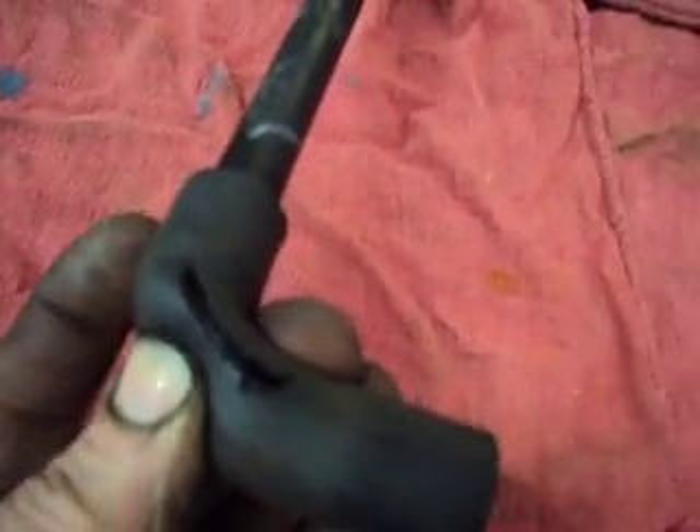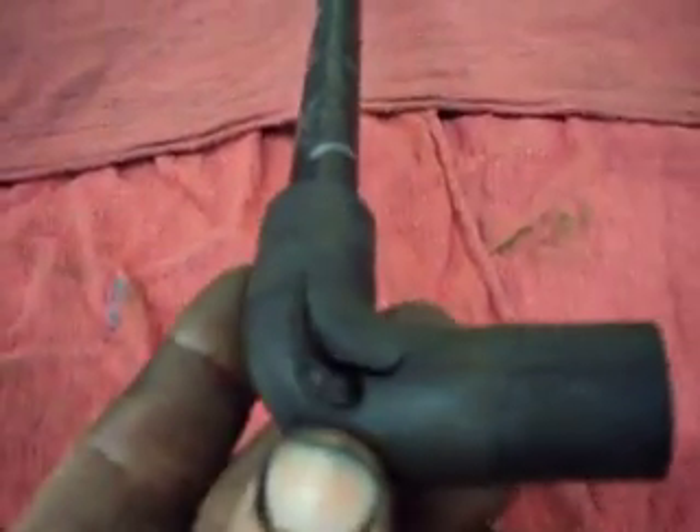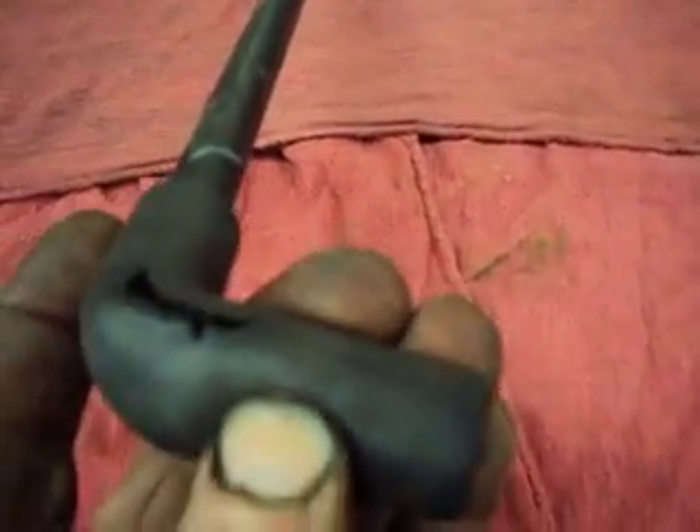The problem is that you get a lean code, and the lean condition is caused by unregulated air entering the intake manifold through the rip in the soft rubber elbow.